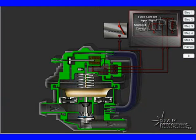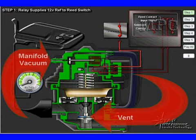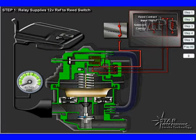Now this is normal operation. We're going to block manifold vacuum with a valve at the top. This is going to keep the vent open so normal canister purge can take place. When we're ready to unblock this vacuum that's been blocked, we're going to energize the solenoid.